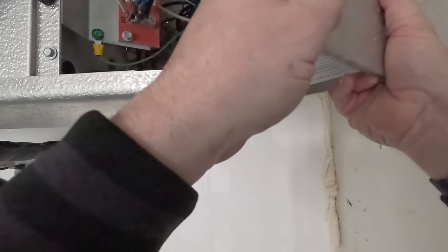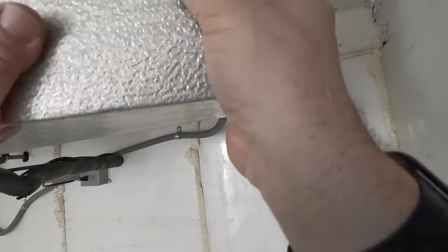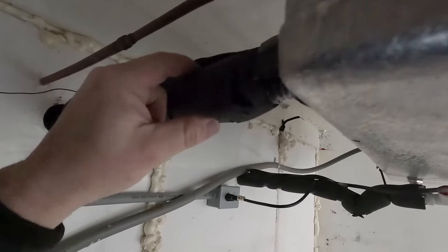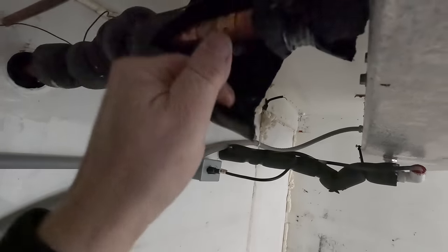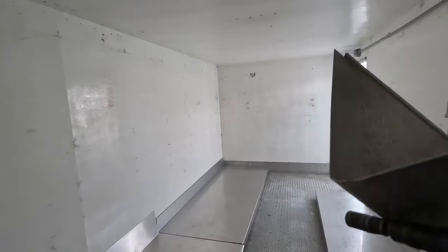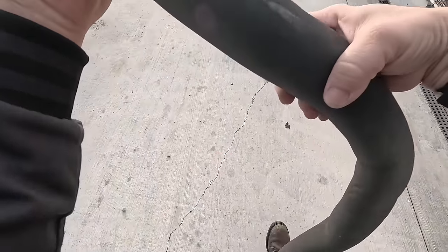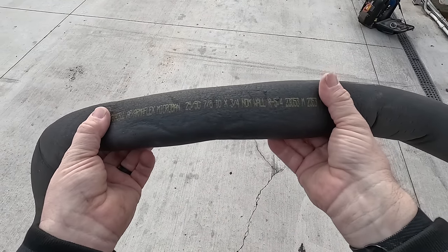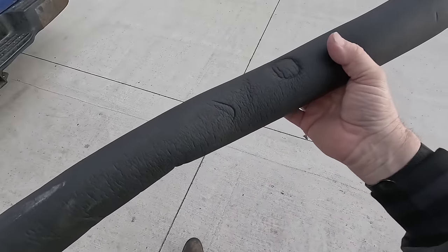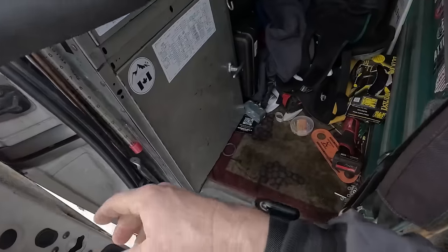The main thing now is making sure that the pipe is insulated as best as possible. As small as this container is, it could easily be getting too warm in here and cause an issue. Let's check how that bulb is — if it's loose — yeah, that insulation is kind of a joke. Let's see if we can get a piece off my truck. I've got a nice piece of insulation — seven-eighths ID, three-quarter inch wall — that works perfect for a freezer. I've got glue. Let's go ahead and split this and glue it together.